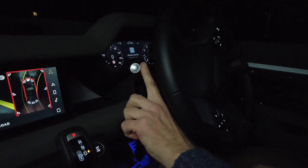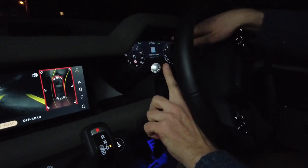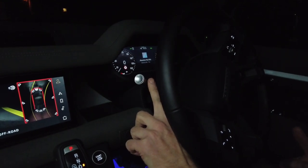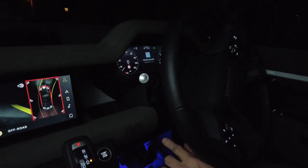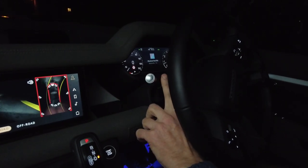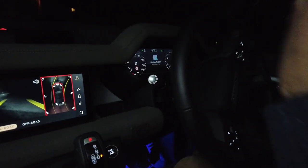When we were driving the other day, twisting wasn't working. There does seem to be another way to activate it: if you push the stalk away once you get main beam, and if you push it away a second time it brings it back to Auto. I think this is actually a better way — press once for main beam, press again for Auto.